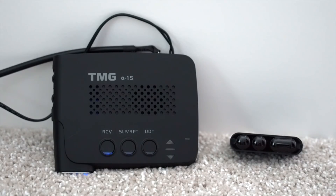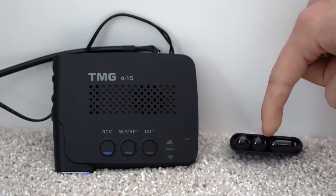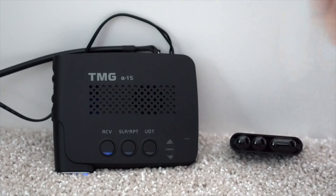Now to show you this, let's hop inside real quick where it's going to be darker and just easier for the camera to see the pulses coming out of the laser jammer. If you take a look at the head, this middle dot right here — that's where the transmitter is installed behind. Let's take a look at what the auto JTK looks like and when the jammer actually stops firing the laser. Front laser. Marksman or Ultralight 2020. Auto sleep on. So you can see after it finishes saying 'auto sleep on,' that's when the jammers will disarm.